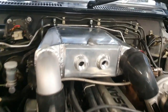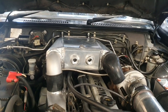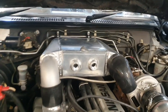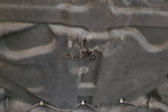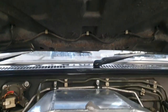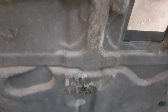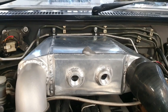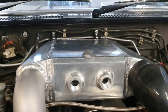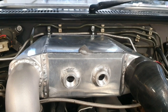The old blue tack test — blue tack on top of the intercooler, close the bonnet. Excess clearance is definitely not going to be an issue with this. It's got minimal clearance — basically none. That hood liner, which you can see is munted from rubbing against those hose clamps I mentioned earlier, definitely hits that. I don't think the bonnet will — just the hood liner. So we can chop a hole in it if he wants; I'll talk to the owner about that. It's not in fantastic condition anyway. A carefully cut hole just to suit that highest edge towards the front there won't do any harm — or just leave it rubbing.